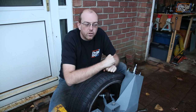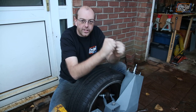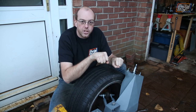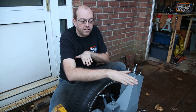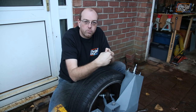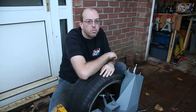Unfortunately, if you put so much adjustability and freedom of movement that every single point has a big adjustable rose joint on the end of it, nothing stays still. It had been staying still when we'd been building it and nicely positioned, but by the time you get the weight of a wheel and the ground to push against and jump up and down on the suspension, it finds its own level and its own natural resting point.